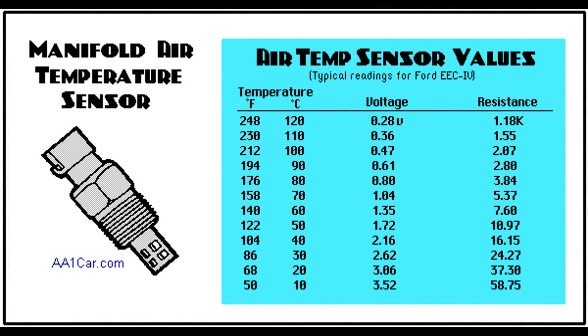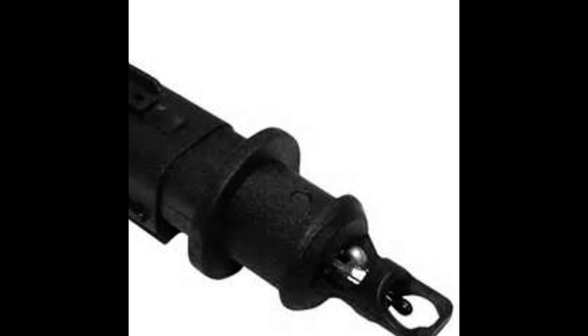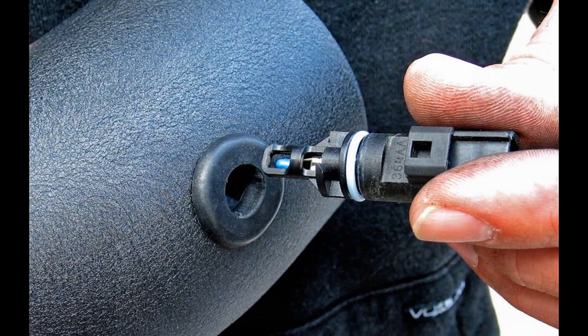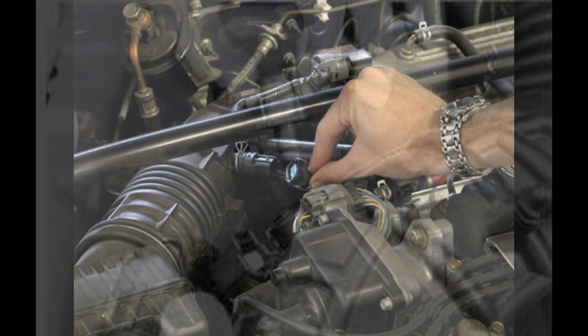So what does it do? It changes your ignition timing. Ignition timing will be faster when cool air is coming in, because there is less risk of detonation. And when you drive in summer and the air is hot, the sensor sends a hotter temperature signal. It makes your ignition timing later, so fuel is ignited later. This reduces detonation risk.